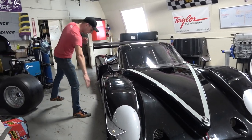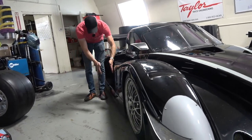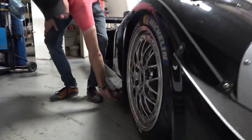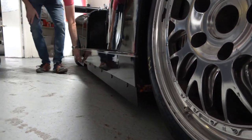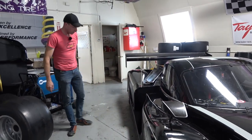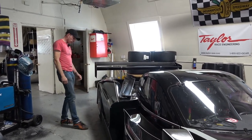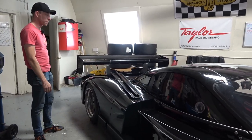There's a certain amount of airflow coming on the side and then it starts to come inward, creating a lower pressure as it comes back. Down the side there's a real interesting flexible plastic skirt — not too different from what was on ground-effect Formula One cars in the late 1970s, creating more of a channel that can rub and whatnot. We could maybe make a different one out of polycarbonate, maybe even put a little flexible skirt on it to really direct the air underneath. It should be a lot of fun for Genius Garage students to mess with the aerodynamics.